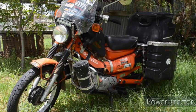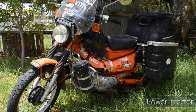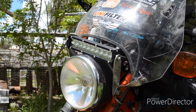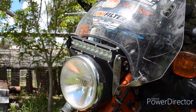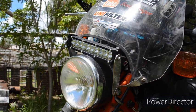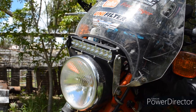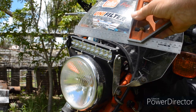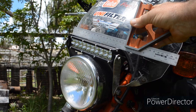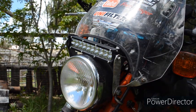Well, I have finished fitting the light bar. I think it looks not too bad — let's get a bit closer and I'll explain exactly what I did. If you've seen my other videos you'll know that this bike was originally 6 volt but it's been converted to 12 volt electric, so this is a 12 volt LED light. I bought one that's more or less six and a half inches wide — 165 millimetres — more or less the same width as the headlight.